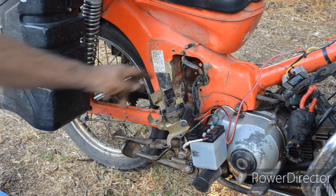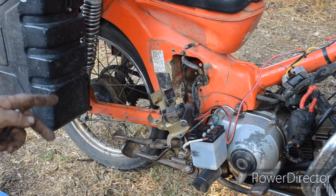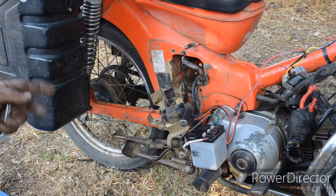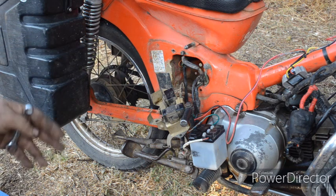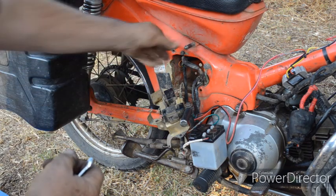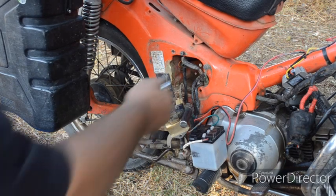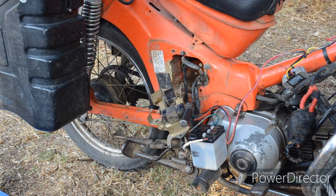Because of the size of the battery on the 12 volt bike, they are mounted on the outside across that bridge. And now you'll realize the wiring is quite a lot different. What I intend to do is use the wiring harness from the 12 volt bike — I don't want to butcher up my 6 volt harness. I want anything I do to the bike to be reversible, not permanent. I'll lift up the seat and fuel tank — there are two bolts and two nuts in there — undo those and the coil drops down with simply one wire onto a terminal.